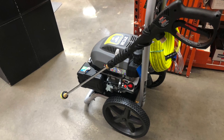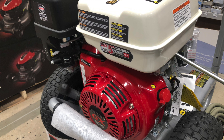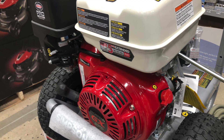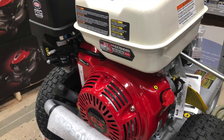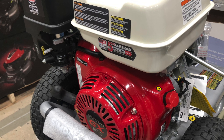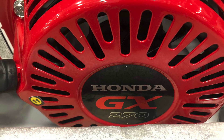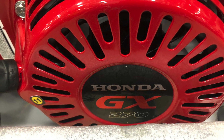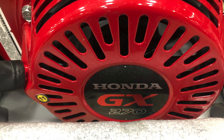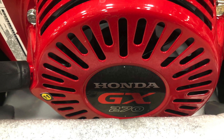Make sure you use the proper fuel in your pressure washer. This new ethanol fuel is really tough on pressure washer engines and any small engines. If you're going to leave the machine set up for more than a week or so, I recommend running the gas out of the engine. On a Honda engine, you take the black lever under the gray lever, turn the gas off, and run the engine until it quits — that means there's no more gas in the carburetor to gum up. If you're going to keep fuel in the tank, use a gas stabilizer like Stabil, otherwise your gas will get varnishy and mess up your carburetor.